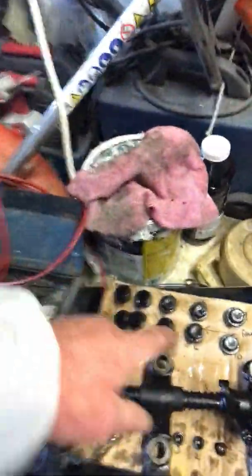When you're taking the bolts and the push rods out, remember to put them all into a box so they're all in order, and number them, stick them through cardboard or something, which I've actually done here. That's the rocker. I've stuck them all on there into that box. If you're a little bit worried about the tubes where the spark plugs go, you can actually get them out with a mole wrench, which I managed to do. I heated the tubes up with a blowtorch, used a freeze release, and did that alternately. Then using a mole wrench I was able to work them all off, so I could actually get at the spark plugs.